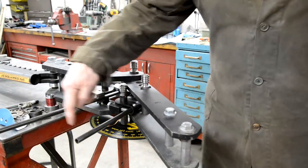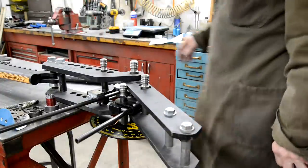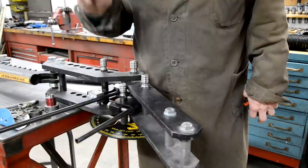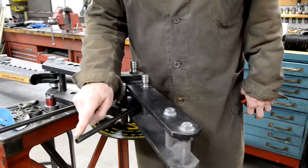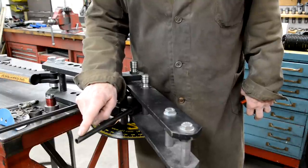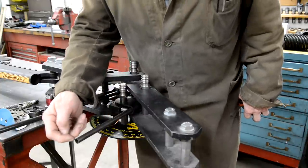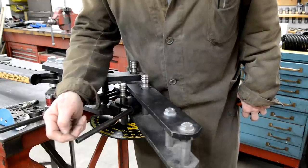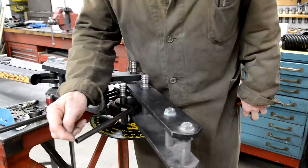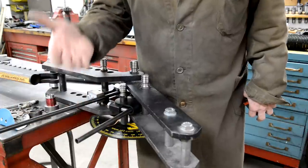Now, let me go and make a measurement about how far across it is to where we're going to bolt it. Right, it's 6.5 inches if I mount these on the inside of the mounts, 7.25 if I mount them on the outside. Now then, don't forget, when we squish the ends, it's going to go in, well, only 1/8 of an inch, actually, because this is 1/2 inch thick, so it's 1/4 of an inch from the inside of the wall, or 1/4 of an inch from there to the centre. So when we squish that up, it's only going to be 3/16. So yeah, it's barely going to be 1/8.